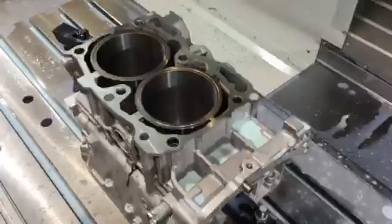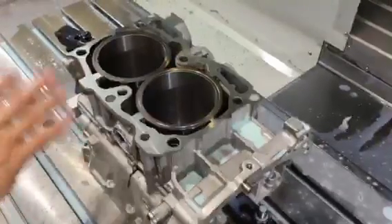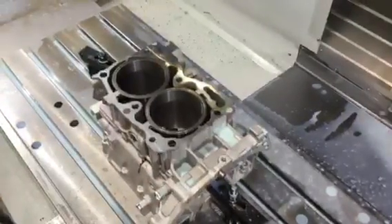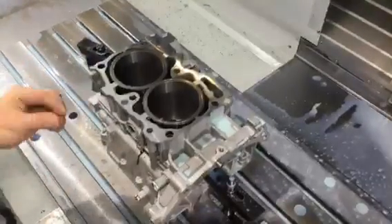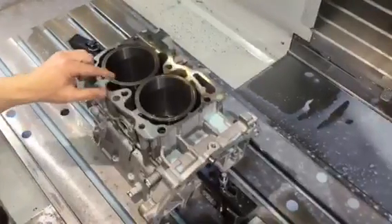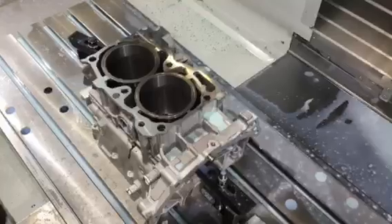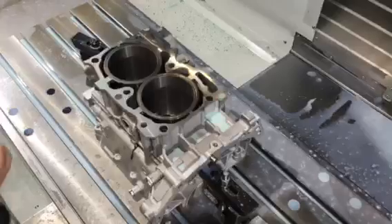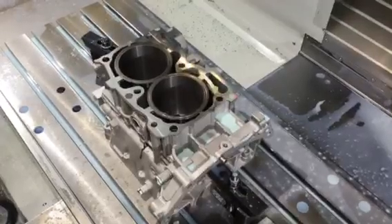Another suggestion: when you guys do your rebuilds and you pull the head gasket — any time the head has to come off the engine — you have got to remove the o-ring out of the groove and put new stuff in it. You'll use a very sharp, tiny little screwdriver we have modified to do this, and some picks. You will pick the groove up a little bit and get a little bit of burrs there; it's very difficult not to do that. It's not a big deal — you can take a little sharpening stone, just kind of deburr it, and you'll be good to go.